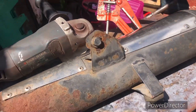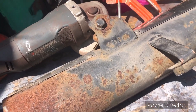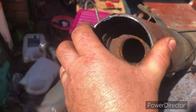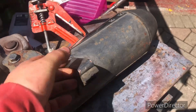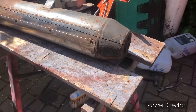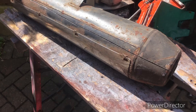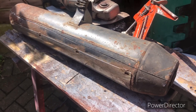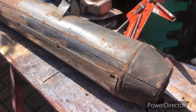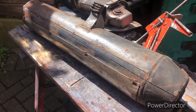I've cut off the old silencer - just look at this, it's absolutely ridiculous. It weighs an absolute ton and it's completely solid. This is what a 75 decibel silencer looks like, and that is just going to knock hell out of the performance. I would suggest that is actually a factor in why these engines can overheat at high speed, because it's not going to allow the engine to breathe properly. There's also restriction in the downpipe itself - as if the silencer wasn't enough. Just awful - I guess that's just the regulations.